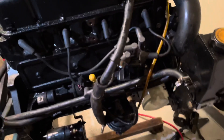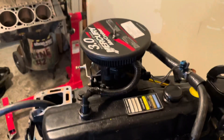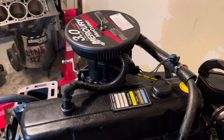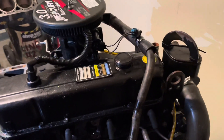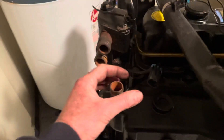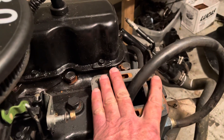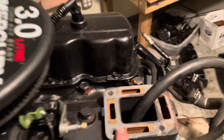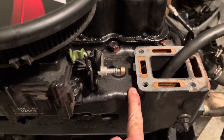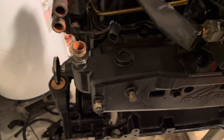At this stage, the next step is to take off the fuel pump, disconnect the line from the carburetor, disconnect this rubber hose, remove the water pump, the starter, and then take off the manifold. I'll leave the carburetor bolted to the manifold for the time being. I'm also making a test tool to test these manifolds — basically devising a way to put a rubber hose on here and then apply compressed air or water on this side, with a gasket and a solid steel plate to block the other side off, so I'll be testing the water jacket side of this combination intake-exhaust manifold for leaks.